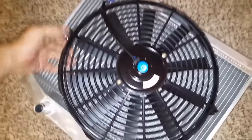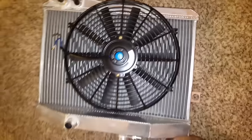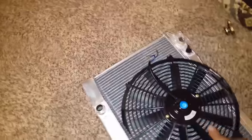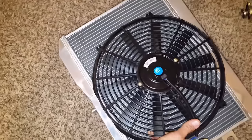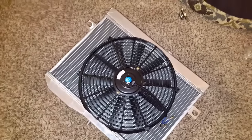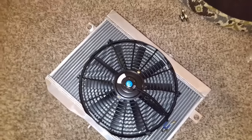That 14-inch blade is actually bigger than the radiator. I'll have to put the 12-er on this side and put the 14 as a push fan on the opposite end of the radiator. The brand — I'll put in the description, I don't remember exactly what brand this is. It sounds cheap, they do a lot of motorcycle stuff. Wow, 14 doesn't even fit on that end. We'll figure something out here — I'm sure I'll make it work.